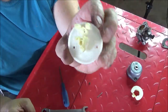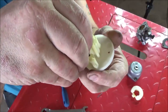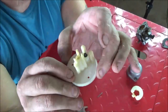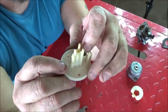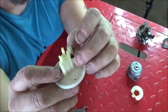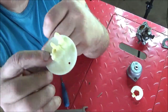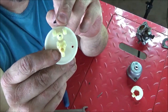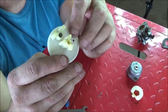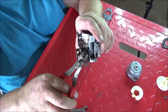If your carburetor is flooding and you put a new needle in and it still floods, you're going to have to replace the whole assembly. You can get it from Briggs or aftermarket - I've never had a problem with the aftermarket one. What happens is, even though you have a new needle, the seat down in here gets worn and just won't seal anymore to hold back the fuel. Go ahead and get a pair of needle nose pliers and pop the limiter cap off of the idle mixture screw.